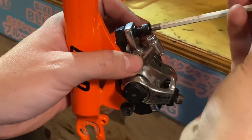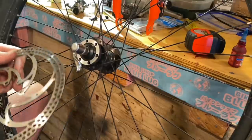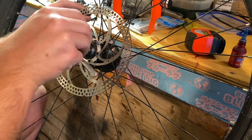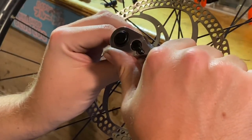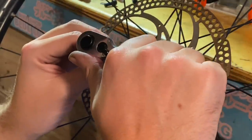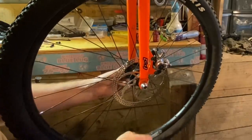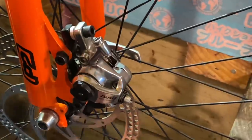This is my first time setting up Avid BB7 calipers in longer than this lockdown, so I completely forgot about using their washers. I realized after putting the wheel in and it was scraping a little bit that it definitely needed some spacers underneath. They get set up like a V-brake pad, with washers before and after the caliper. I also changed the quick release skewer so it's on the opposite side to the disc — just to avoid grabbing the disc when you tighten the skewer down. It looks a bit worse from the drive side, but it's a lot more practical.